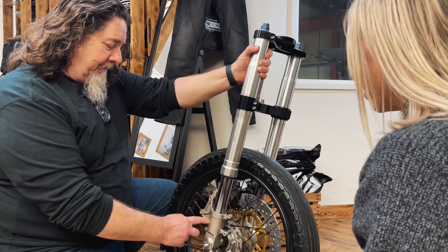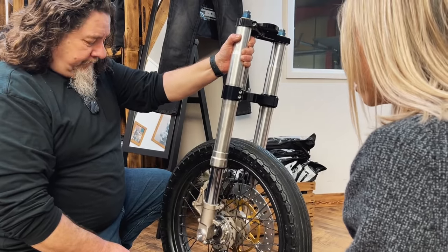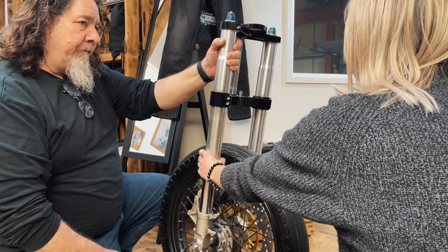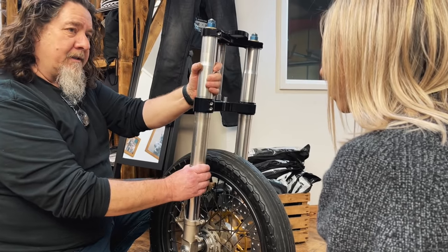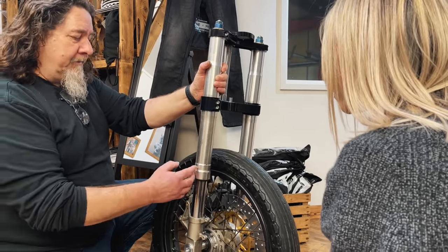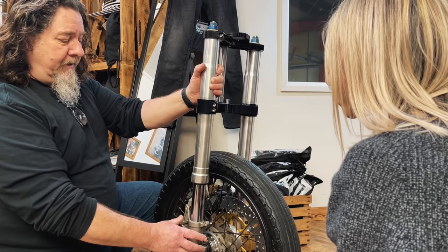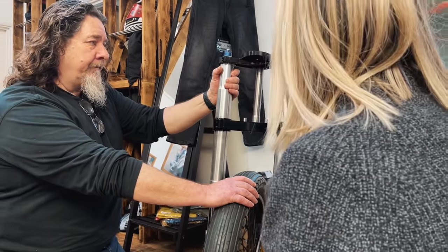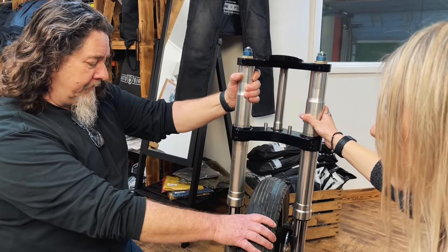And you're going to remove that? Polished, or? Probably polished, because I'm polishing the tank at the moment and there will be some parts polished. I'm not sure what I'm going to do with this because it's old. I'd recommend Cerakote over anodizing. Okay, Cerakote that. With anodizing, you need to strip everything out of the centre of the tube. Cerakote, you can actually do in situ, all built up. Are there any other options? You can just use normal paint if you wanted to.